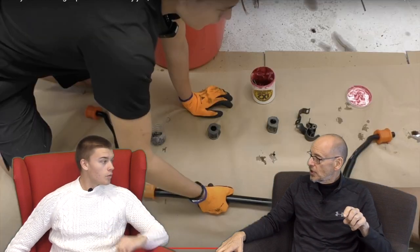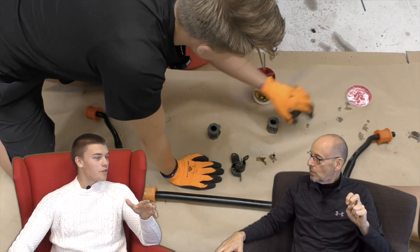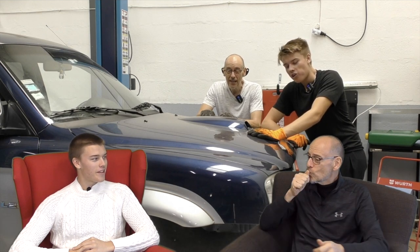Then we tackled the polyurethane bushings, and that was a struggle. We found out we were doing it wrong. I watched videos halfway through because we were getting so stroppy over it trying to get the sway bar on. Dad was cursing over the bonnet because I would be holding something and he'd yank it up with his full weight - and he did crush both my thumbs. It turns out it's easier to replace the two inners or two outers first - don't take all of it off because obviously then it's not aligned. We were fighting with the car up in the air. It was much easier to put a bit of weight on the car at the end. If you're tackling it for the first time and you want to see what not to do - don't do what we did. We did learn something and we enjoyed that.